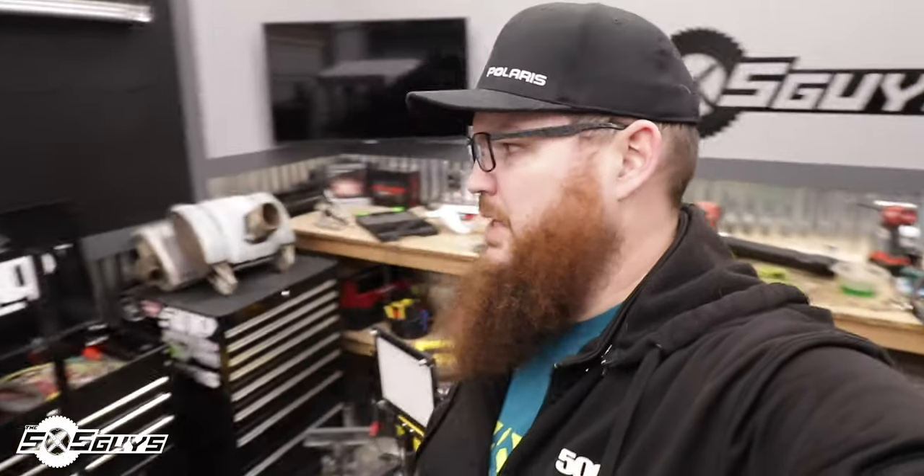Just took the Turbo out for a test drive and the clutch performed awesome. Before we cleaned and did maintenance on it, it would get real jerky on takeoff — just slipping. The dirt buildup on the sliders and shafts meant that clutch probably wasn't engaging smoothly for a long time. Now that it's fixed, it's great. Heading out to Winchester Bay to hit some dunes, teaming up with Ian from Full Throttle Battery and a bunch of guys from Pacific Northwest Facebook groups along with some industry guys. Should be a fun weekend — until the next one, peace.